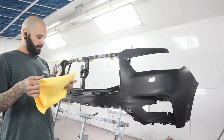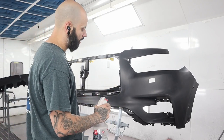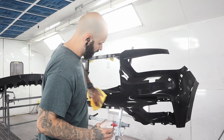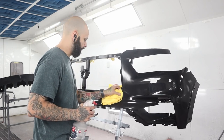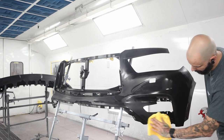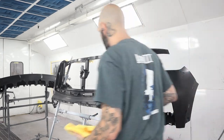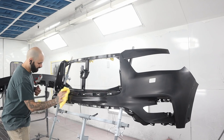I'm using SC-159 anti-static cleaner — basically just an alcohol-based cleaner — and when you go to clean this, you want to saturate it: every nook and cranny, get it all soaked. The reason I use an alcohol-based cleaner is it evaporates — it's not going to leave any liquid behind. It also helps reduce static, which on plastic can attract dust and dirt and make for a nasty paint job. The same process applies on fiberglass parts.